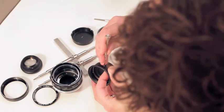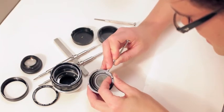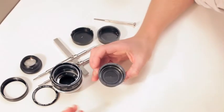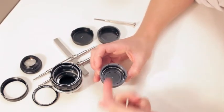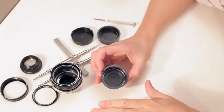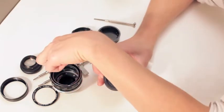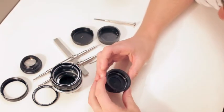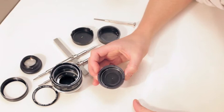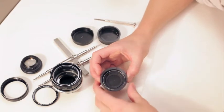This lens is finicky — it's not a favorite of mine to clean. If you're cleaning fungus, a lot of times fungus will seep in through or grow in between the elements around the aperture. So you don't have to pull any of this apart to clean that — it's going to be opening the aperture, cleaning the rear element, and sometimes that's enough. What happens is water gets sucked in through the breathing of the lens when you focus it on a rainy day or in humidity, and it will grow in there — though a lot of times it's between the aperture blades.